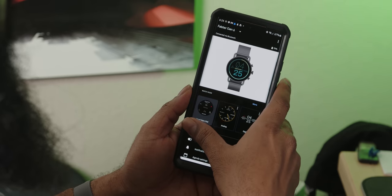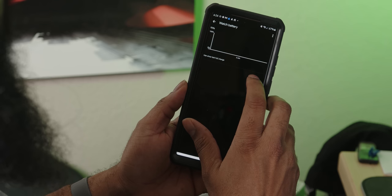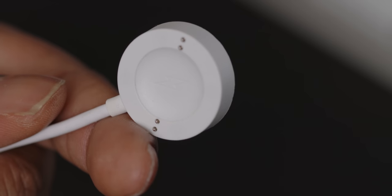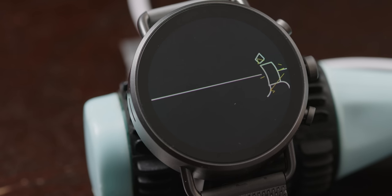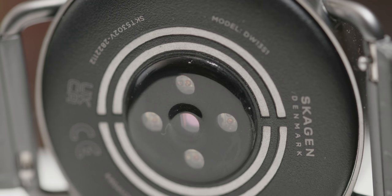If you do wear this watch to bed to track your sleep, it's good to know that charging is also improved from last year. I get around a day and a half out of the watch, so I end up charging every morning while I get ready for work. The good news is that within an hour I can charge this watch up from almost dead to 100%, because the proprietary charging puck — no wireless charging here — is now a four-pin affair as opposed to last year's two-pin charger. While you wait the short time to top up, you can watch a fetching charging animation. Also different from last year: the charging contacts on the back of the watch body. Previously glued in, there were complaints from users that they came undone, but this year they're built into the body, which should make them more durable.